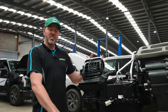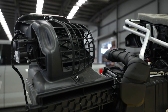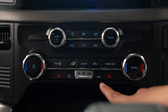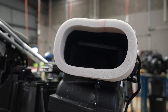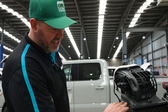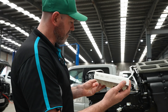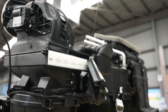This is the fresh air intake. Everyone will be familiar with the button on the dash — fresh or recirc, the little picture of the car with the recirc arrow. When it's on fresh, it draws air from outside of the car, from basically where the wipers are. It comes into the heater box, down into the pollen filter, which is in behind this door here. These heater boxes use the original OEM Ford pollen filter.